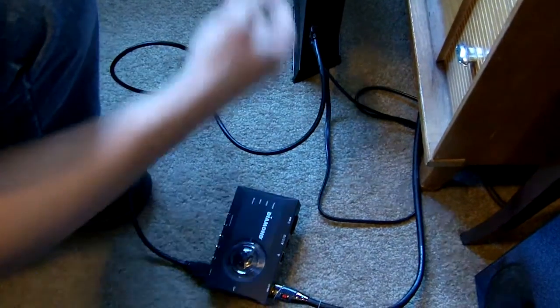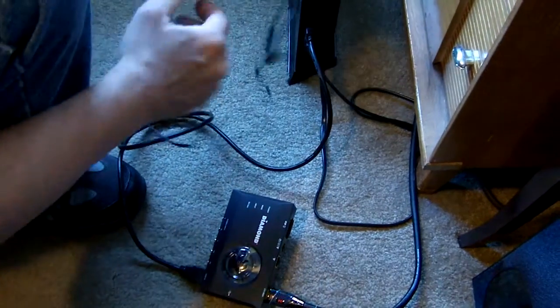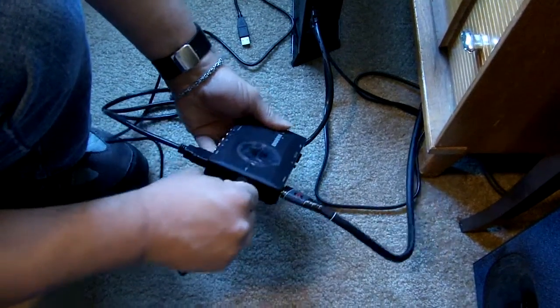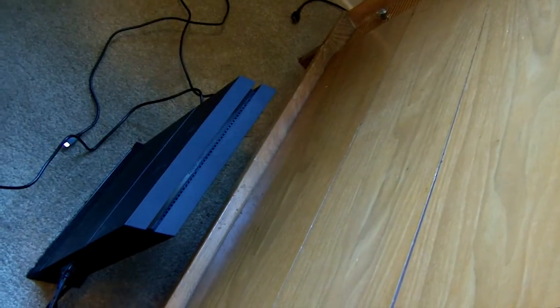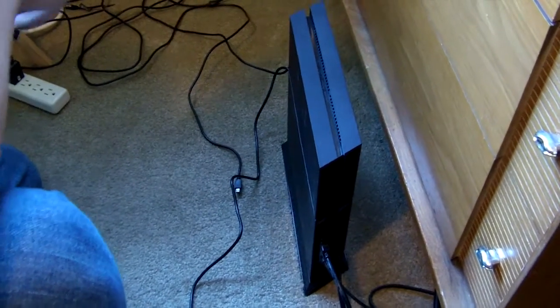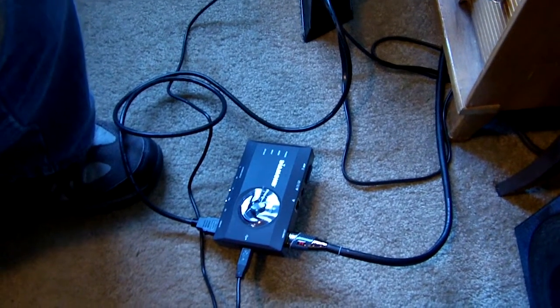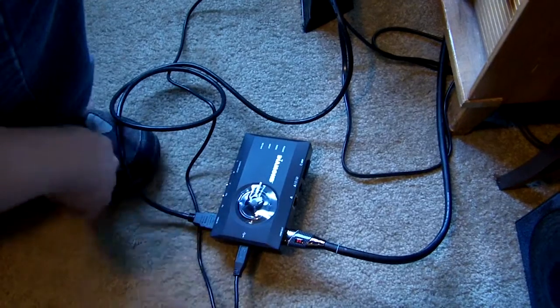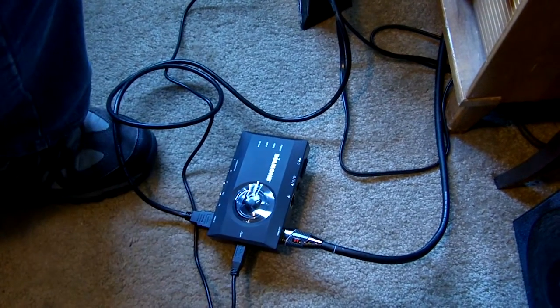The USB cord — you can power this several ways. The easiest and most common way is to just plug it into the box and then into the USB on the front of your PlayStation 4, and it handles the power of the recorder for you. With that, you're ready to go. You'd turn on your PlayStation 4 and everything would power up after a moment. To record, once your settings are right — and we'll show you how to do that in just a moment — you just click the big button and it starts and stops your recording.